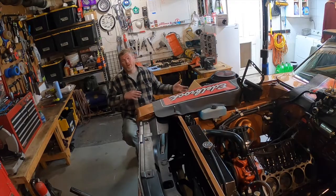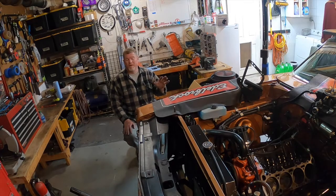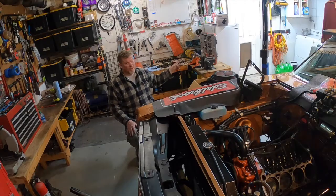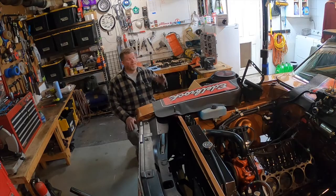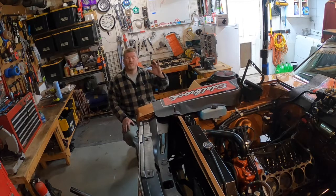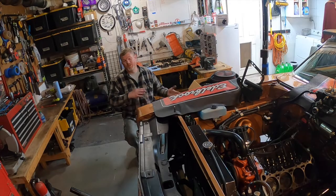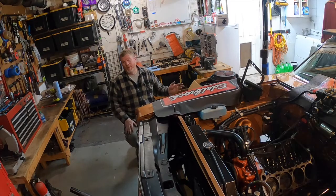What would happen is we'd effectively run at a top end around 5700 RPM and really lay down on its nose. There are a couple of things we're going to be changing prior to getting the charger dialed in before this June's Hot Rod Power Tour. Number one being the cylinder heads. Number two, given that we have 700 foot-pounds of torque and a 30-inch tall tire, we really don't need that much gear — we just have a really steep gear that isn't necessary. Especially as we drag race it, we're on the high end as we pass through the traps, and we want to bring that RPM down just a little bit so we're not bouncing off the rev limit.